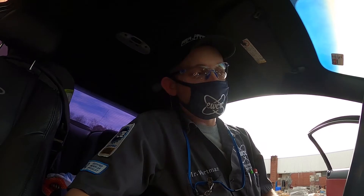A little bit more on MAP sensor readings — I'm going to give you another example on a car with a performance camshaft. You'll see a little more fluctuation on MAP sensor readings, as we did with the vacuum gauge where we had some fluctuation and a lower vacuum reading. That's kind of a side effect of the performance camshaft. I'm going to show you the scan tool data on this 2006 GTO with a pretty wild performance street cam. It's not the craziest camshaft in the world, but it's on the higher end of a street car camshaft.